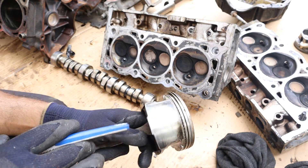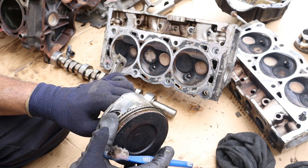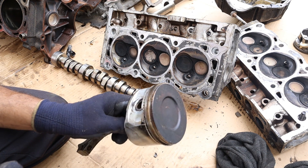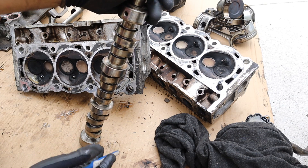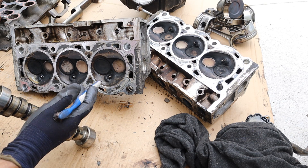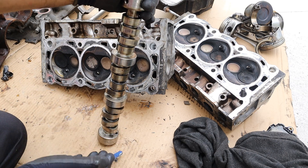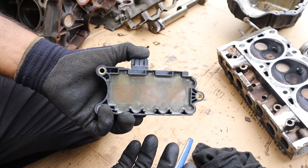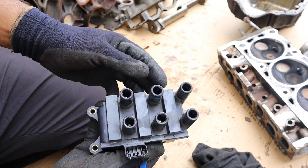You can also tell this is an old school design by the look of the piston — you'll see that the oil control ring is nice and big, which means it won't get clogged up really fast and allows the oil to flow back. You've also got nice big heavy-duty compression rings and this thing does feel pretty solid. The piston itself is actually pretty clean — there's a little bit of scoring on the side for some piston slap, but for 300,000 kilometers I think it did pretty well. The bores inside of the cylinders are actually pretty clean as well with no evidence of piston slap, scoring, or lack of lubrication. This camshaft that sits in the block is nice and simple. Because it just uses push rods you don't have to deal with any timing chains in the head, so when the head gasket is going to fail you don't need to deal with any chains or timing the engine. It does however limit you quite a lot — you can only run two valves per cylinder and you can't have things like variable valve timing and VTEC. Ignition coils are another weak point of this engine and they burn out pretty quickly. I can tell this one's not original — there's no Ford part logos on it. You can see the three distinct coils inside, and you have to double fire per cylinder. Replacing this part is pretty straightforward and luckily it doesn't use a distributor or even a carburetor.